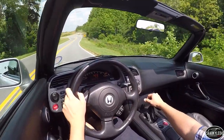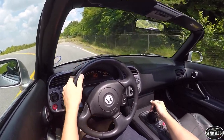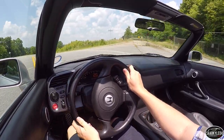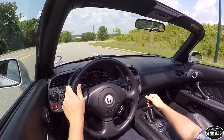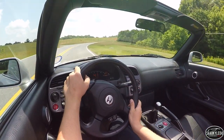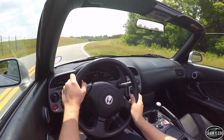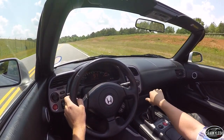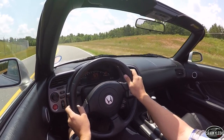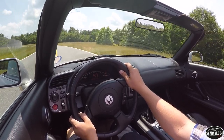The S2000 also features a 4-wheel double wishbone suspension with coil springs, monotube shock absorbers, and anti-roll bars front and rear. Compactness, a continued theme with this car, was part of the driving force for this setup. Honda calls it an in-wheel suspension, very similar to what you would see in an NSX. It allows for less unsprung weight and high rigidity while ensuring the hood could stay as low as possible. Unlike the NSX suspension, which primarily featured aluminum, the S2000 suspension is primarily steel.